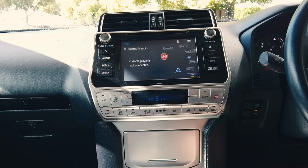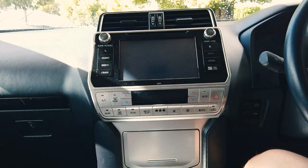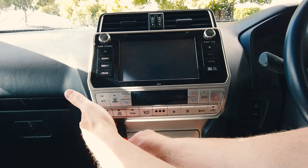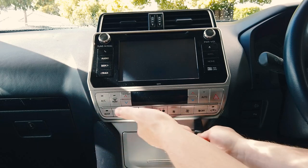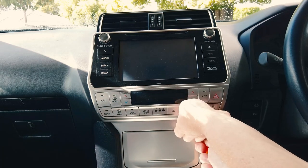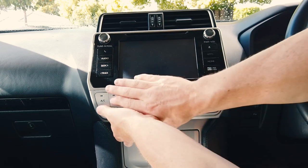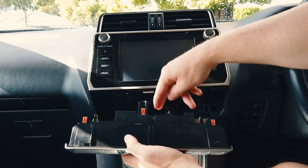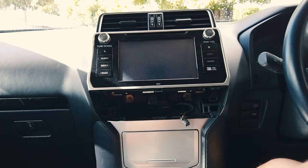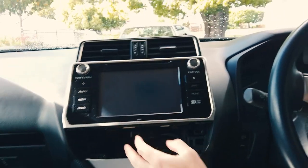Prados are a pretty easy install. The first thing you do is grab your trim tool that comes in your kit. If you have your door open and hear the beeping sound, you can press the door rubber sensor and it'll stop beeping. Put your trim tool underneath the aircon panel and lever it up — it's also handy to get all your fingers in there. Under the aircon panel you've got four 10mm bolts that need to come out.